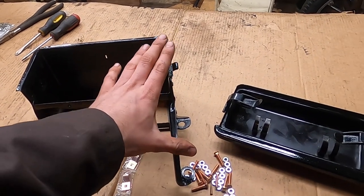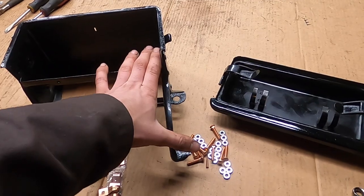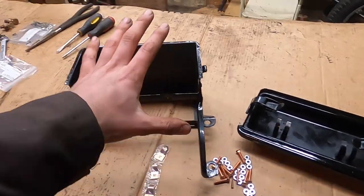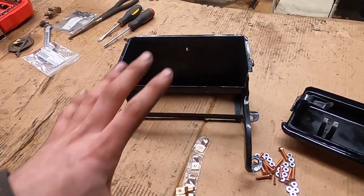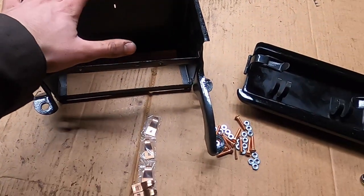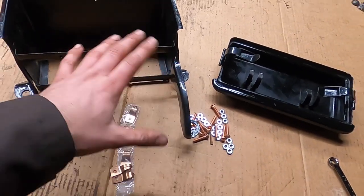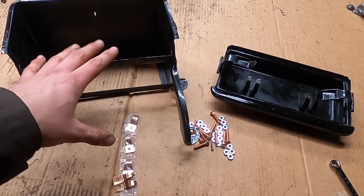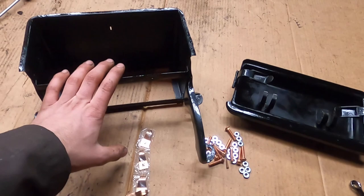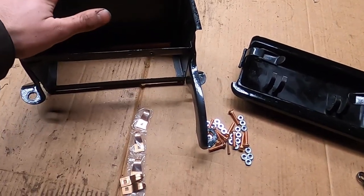On the 26 and 7 cars, this box is mounted on the engine. Earlier cars would have been mounted inside the cowl or on the floorboards or different positions inside the cab, depending on the year. Moving the coil box to the engine compartment for the 26 and 7 reduced the buzzing noise from the coils inside the cabin. Kind of made for a little bit quieter ride.